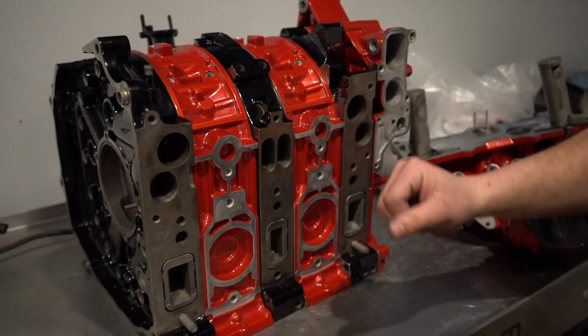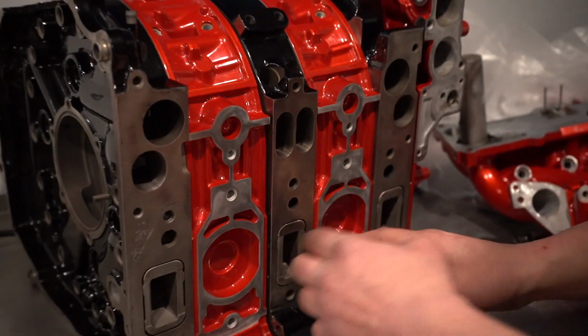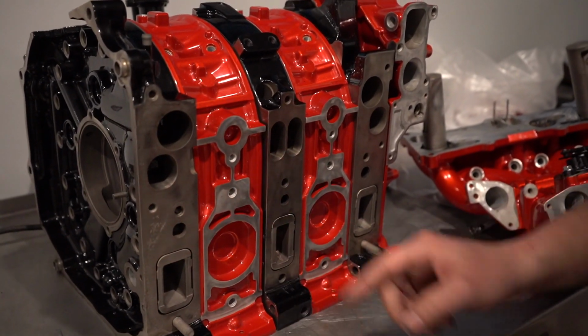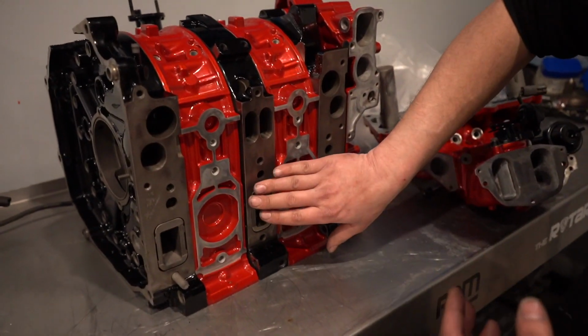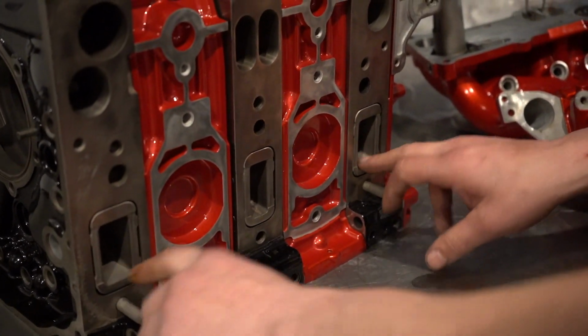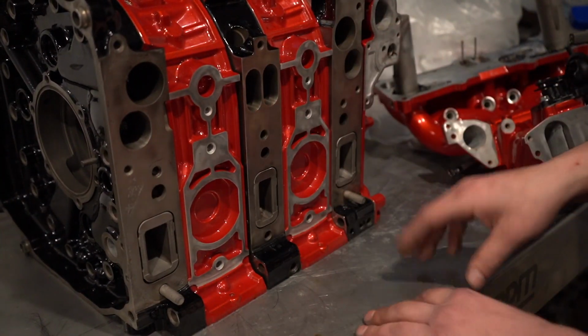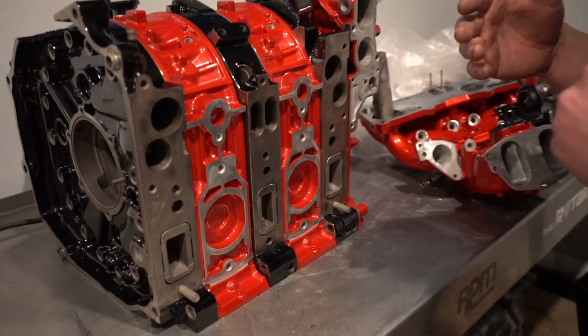The main reason for that is the RX-8 has a very weak exhaust pulse, and it's mainly because it's shared. This port shares both pulses at the same time. The issue with that is your scavenging effect with NA. So I think if we get rid of this and only run the peripherals and just the exhaust out into 2 runners back, with like a full ITB or even this setup, it will yield better performance up top. We may yield an extra 10, 15, 20 horsepower, getting up there with the standard 13B guys.